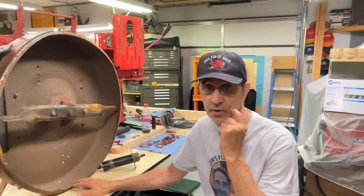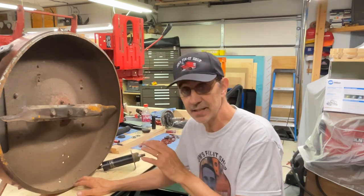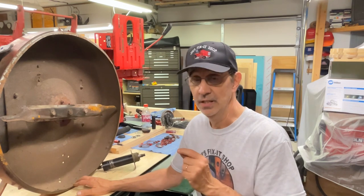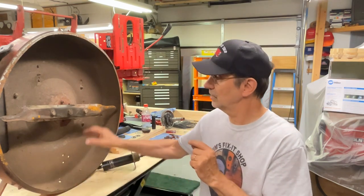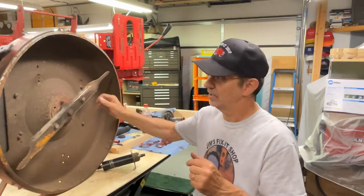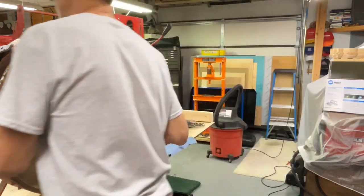What do we do? The video I put on about greasing and oiling the entire machine, I didn't say anything about the deck, because regardless what these people say on YouTube to do to your spindles, there is nothing on the mower deck that needs to be greased. Now you can check — this turns very hard because the brake is on. If you engage the mower deck and put a clamp on the pedal where your feet normally are, that will disengage the brake.